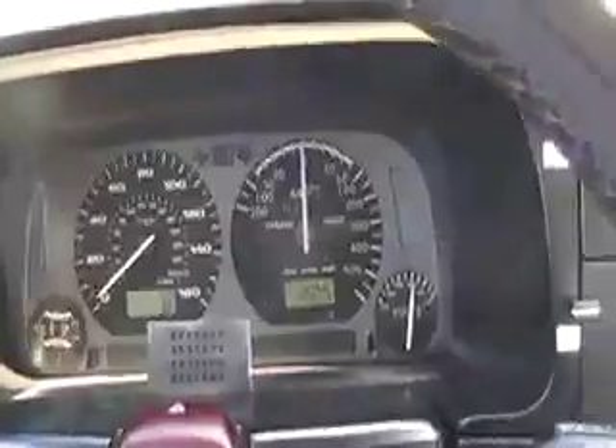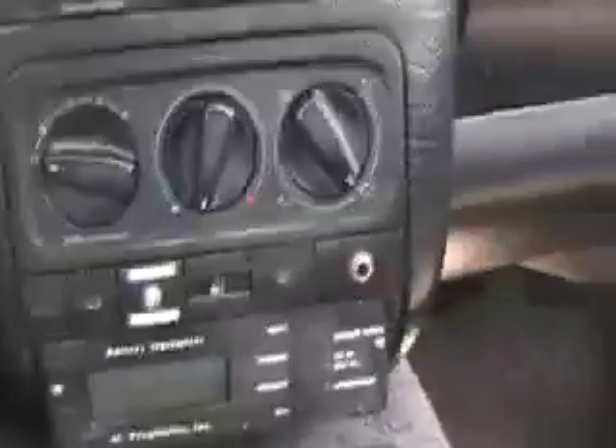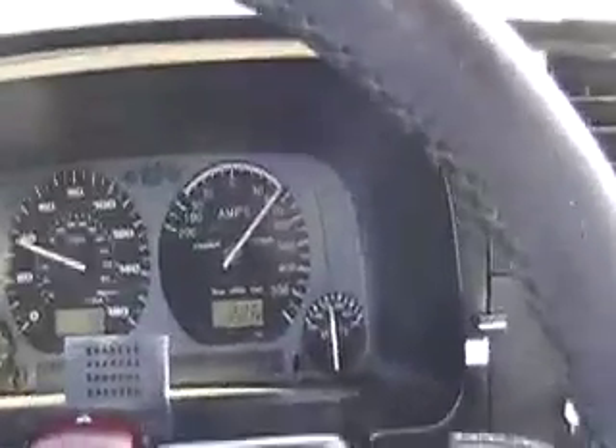These little lights that come on mean that the batteries are overvoltage, so I'm really regenerating more than I can use. It's one of the problems with an electric car — when you're full, you can't absorb regen braking. The idea that the battery always has to be full is mistaken. Here we are at 50 amps, and the voltage drop is very low — we're still at approximately 330 volts.